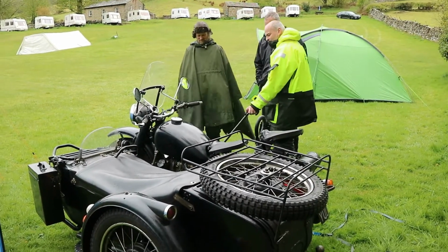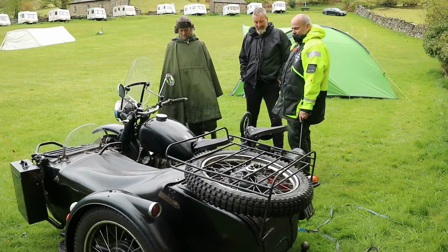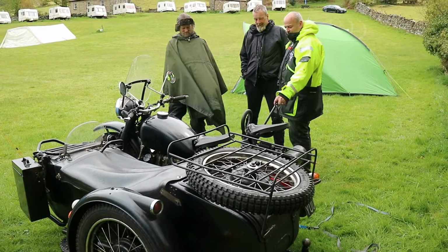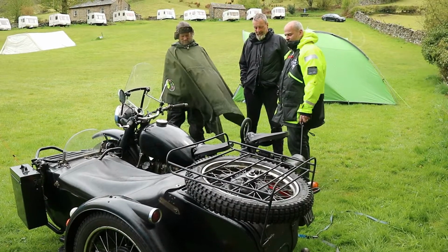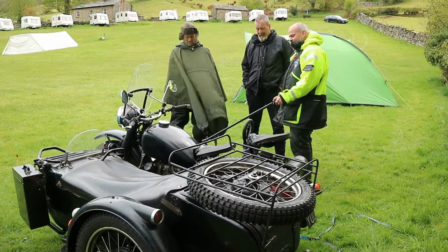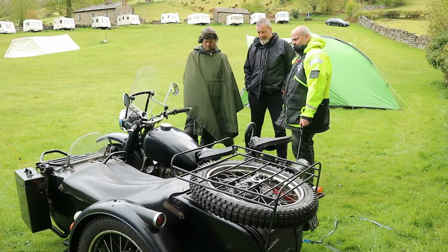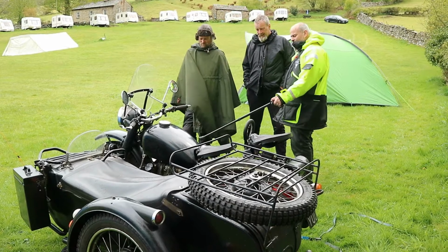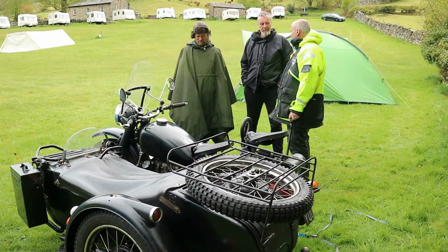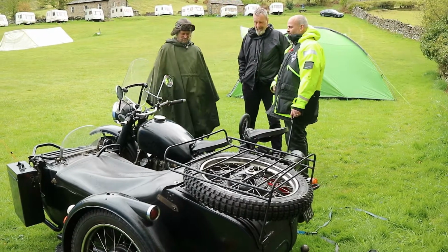And like I say, it's got a BMW alternator in there, straight off the crank. What more could you want? All my electrics are in here. There's the starter solenoid in there, and the regulator rectifier. The alternator's brushed, so it's just a case of replacing brushes, dead easy. That's not a Chinese coil. My Chinese coil cracked in winter. It got caked up with water, and it froze. It just busted it, and it was like Star Wars. It went everywhere.